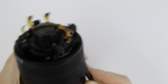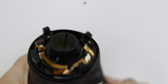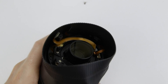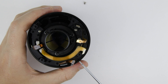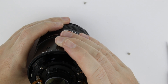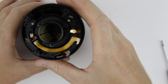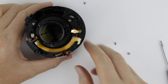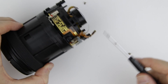Use a plastic spudger to remove the zoom rubber ring. Remove the screw from the zoom lever. Twist the zoom barrel until a point where it could slide out. After we remove the zoom barrel, we can see that the problem is caused by a faulty zoom lever ring — the two screws which were holding it got loose and fell out.